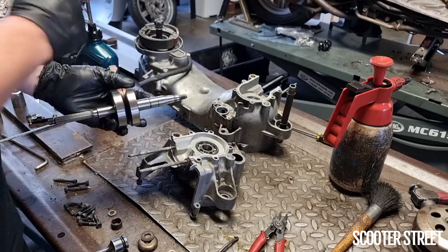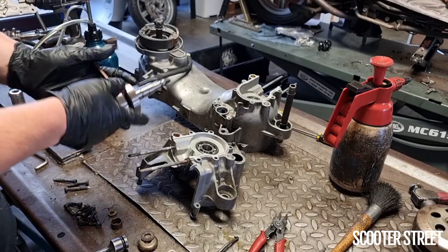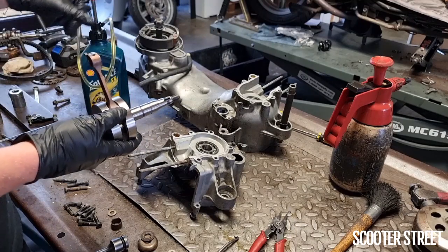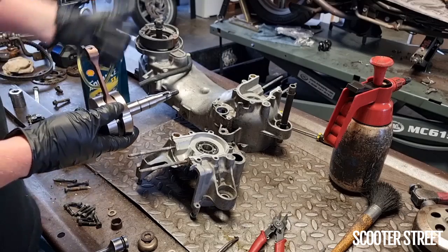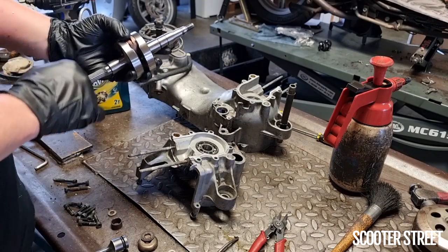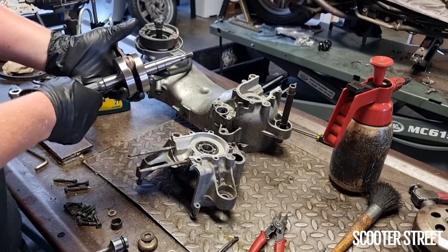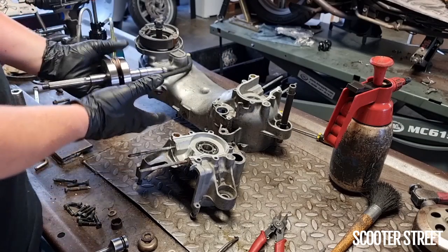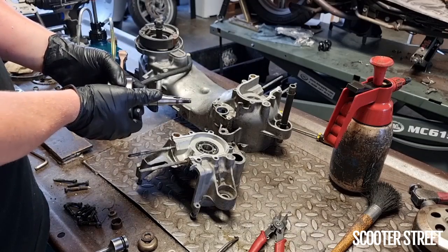So what I'm going to do is use our bottle of two-stroke over here. We've just got a tap on the top of our bottle. It's really good to use a good, high-quality two-stroke oil generally, but when you're doing the engine rebuild, something that's nice and thin, like the Shell we prefer, or the Motul is also a really good product, because it'll get into all the small, fine areas of the bearings and keep everything nicely lubricated and not overheating, and certainly not noisy. The noise isn't the issue, it's that the noise is indicative of a larger problem, which is a lack of lubrication.